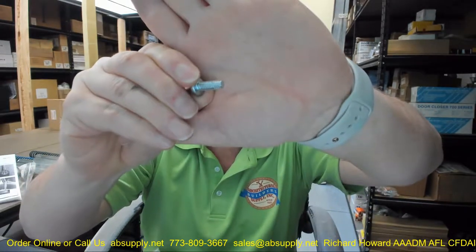You'll drill 14 holes. Attach the new brackets for the lid and curb using the drill and your T30 Torx bit with the 1/4-20, 3/4-inch round-head Torx self-tapping screws. They're thread-forming screws with a profile that clears out the chips. So you're going to use all of those bolts — there should be 14 of them. Indeed, there are 14. That's a nice double-ended drill bit included.